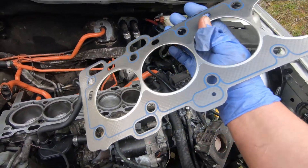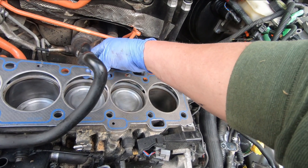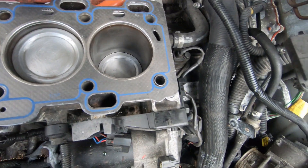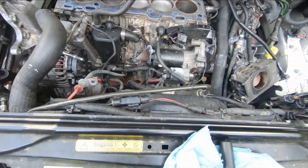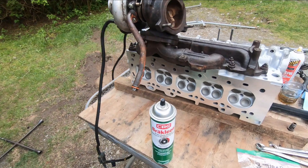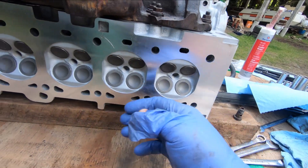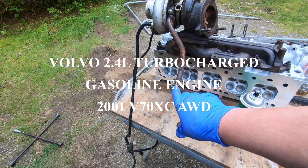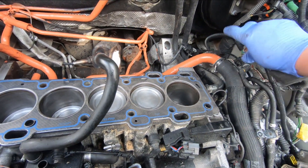There's the head gasket — it's marked 'top' right here. Take one more look at the bottom of the head; there's a little scratch there but I'm not worried about it. The gasket's gonna sit inside right here and the rest looks pretty good. I'm just gonna clean it off with a little brake cleaner, wipe it off, and put some silicone on this tube that goes down into the back of the block.